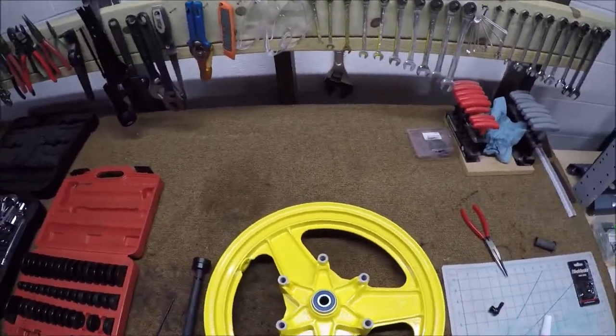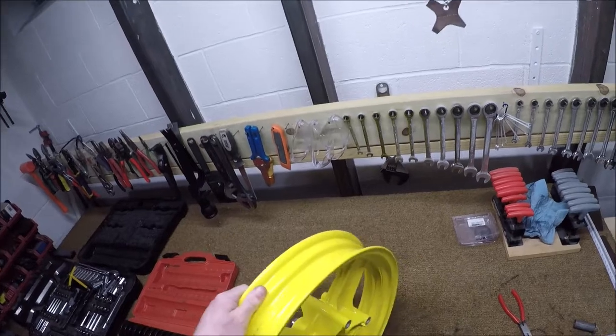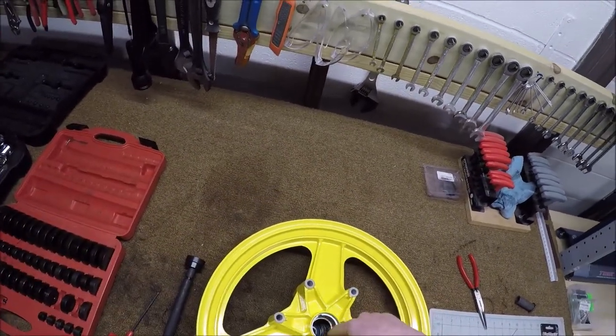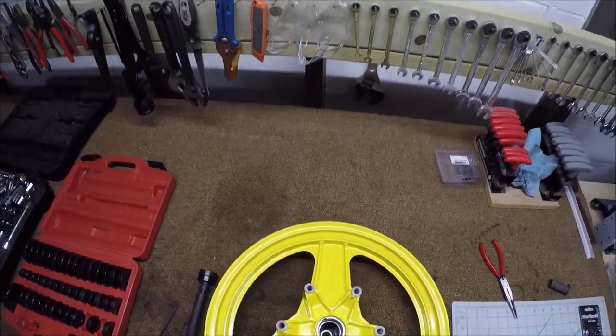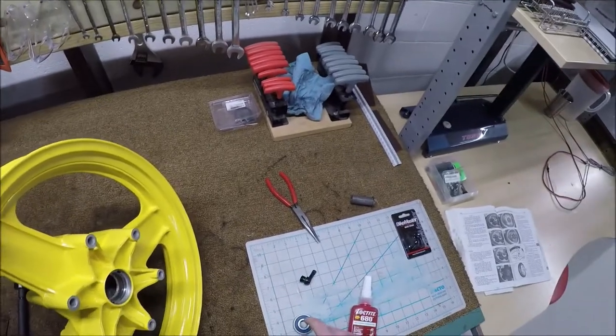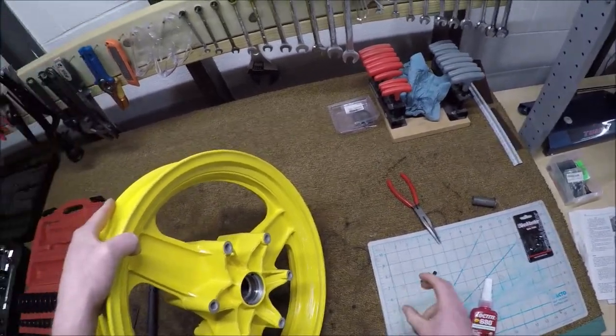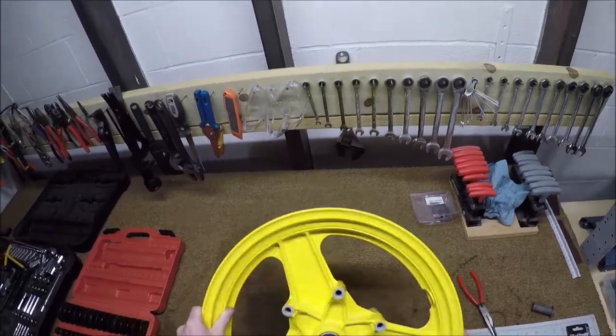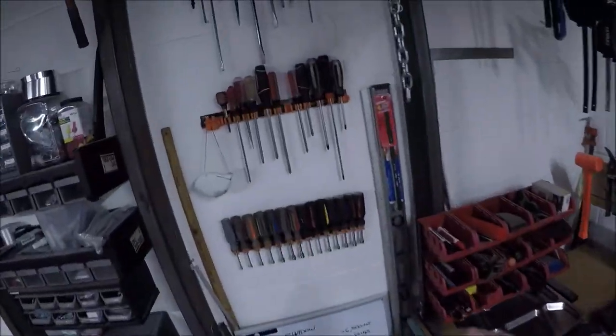I panicked and called a coworker, because I assumed my wheels were trashed, or that what I'd need to do is find somebody to bore out the hub an additional millimeter, find a bearing with the same inner diameter and one millimeter bigger outer diameter, press those in — and that would work. But I need to get that thing out first.